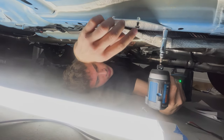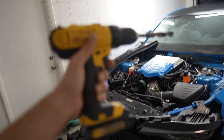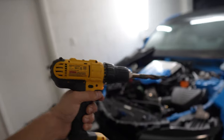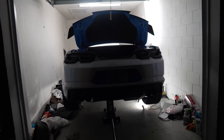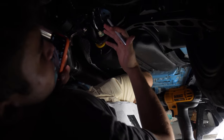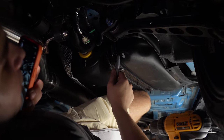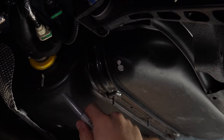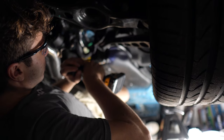Just got the drilling and tap kit in the mail from DSX — they give you the bit and a tap to make the threads. Important to note that you're instructed to jack the car up as much as possible. I currently have it on two jack stands and also put the jack under the rear diff for extra safety. This is a really bad angle but this is where it's supposed to go in, so we're going to drill between the two marked spots and go ahead and drill into my fuel tank. This is scary but we're going slow.